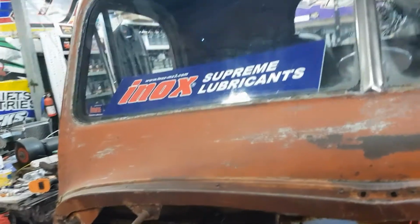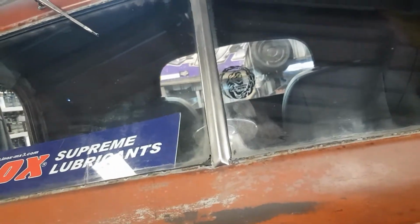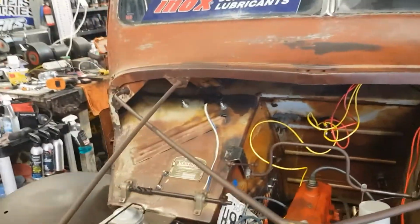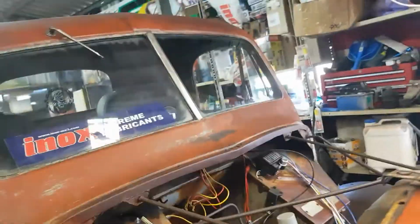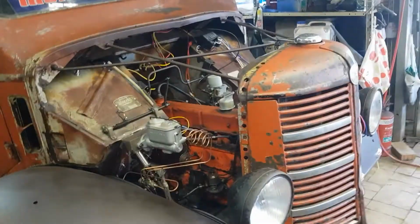At this stage, we're not going to wire the wiper. I'm not going to worry about that. And I'm not wiring up any gauge lights or anything at the moment. All I'm basically wiring up is headlights, indicators, and tail lights. That's basically all I'm going to have at this point, just to get it running and driving down the street. And we'll have the two things I said, the trans thing. And so that's all we'll do to start with.